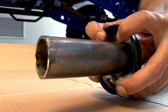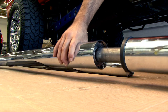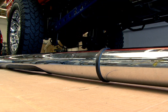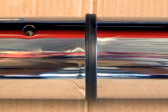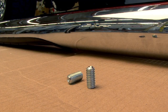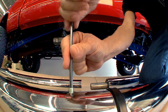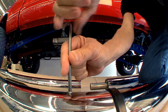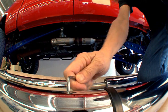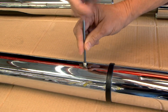Make sure the ring seats completely around the end of the bar. Next, slide the male and female sections of the bar together until the female portion also seats inside the black connector ring. You know you have the pieces attached and aligned correctly when the ends of the bars seat well with the connector ring. Step 2: Insert the set screw. A set screw is provided and is used to secure the male-female coupling. Insert the set screw into the hole on the sidebar and thread it down until it stops. Don't completely tighten the set screw at this point, as you may want to make minor adjustments once the sidebar is mounted onto the vehicle. Hand tightening will suffice, so don't worry if there's some play in the bars.